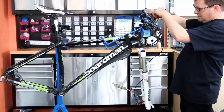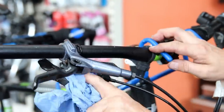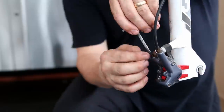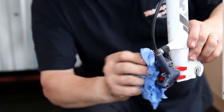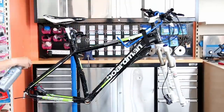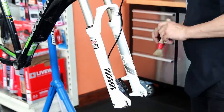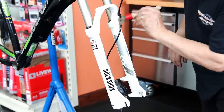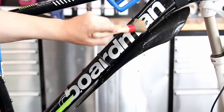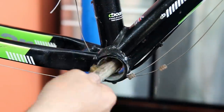I used a bit of brake cleaner here — with DOT 5.1 you always want to keep things clean; don't let that DOT fluid sit on the bike as it will corrode the paint. We used the double syringe method on this particular brake set, cleaned off any residue, and the brakes were absolutely spot on. I cleaned the pads, bled them down, cleaned the discs, and those brakes were as new when the bike was collected — went from having no brakes to good braking power. With the RockShox forks, the bike hasn't done much mileage and they were actuating correctly, so there was no need to strip or service them.